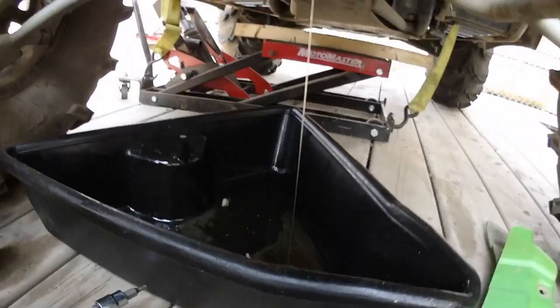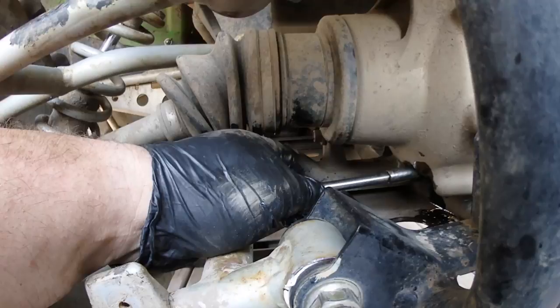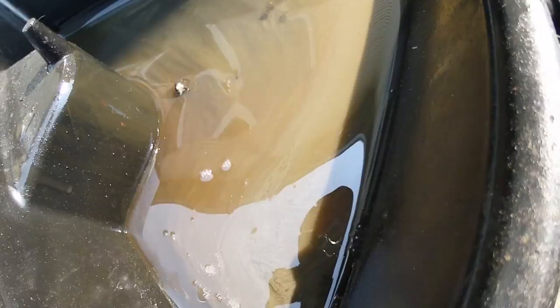At least there's more oil in this one. That's pretty much got a drain. I'm going to put the little plug back in. It might be a bit awkward if you've got fat fingers, but use an extension — thread her in there and turn her in by hand. You can clearly see the water contamination in this one too, but it's not as bad as the front diff.